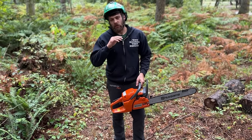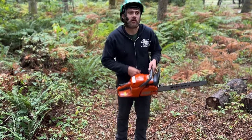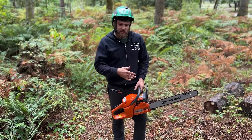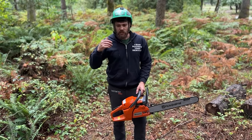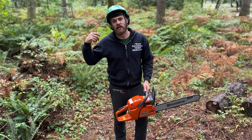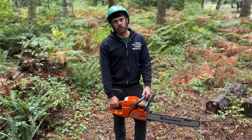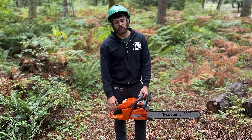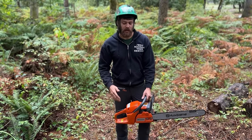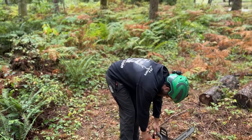I don't recommend that you start the saw this way, but the way I do it is called drop starting, where you use the weight of the saw and push down as you pull up. The advantage is you use that inertia to help you turn the engine over. Professionals, production tree guys, timber fallers, almost always drop start the saw because it's so much easier on the body. You just don't get very good leverage starting it bent over like this.